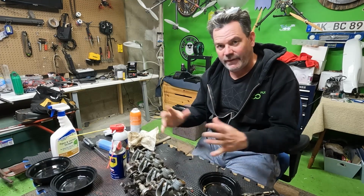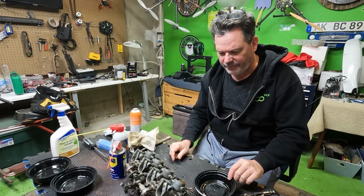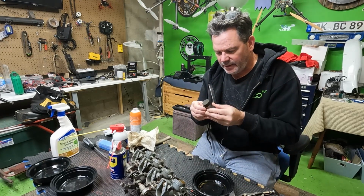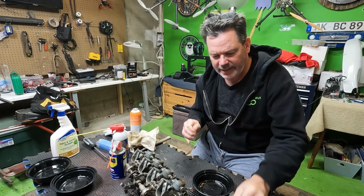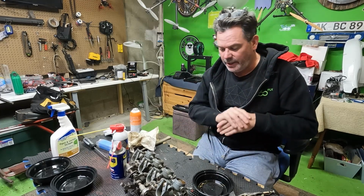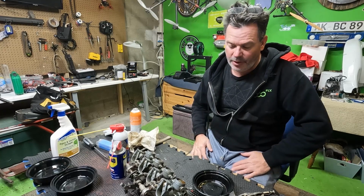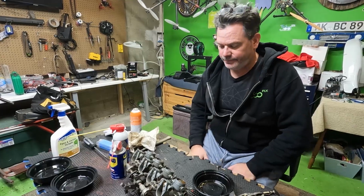And so I don't have a lot of parts all hanging out at the same time. I'm just going to replace one at a time, clean up the bowl, get the floats working and drying them off and just making sure that they're good to go and clean in each one and just go down the line. So I've got to put together my first one that I've learned a lot from, and I'll see you after they're all done, because it's going to be a pretty big job, but it's manageable if you tackle it one carburetor at a time.